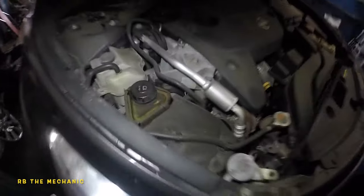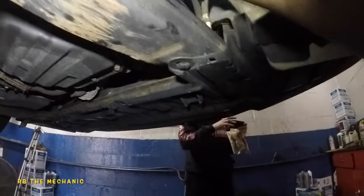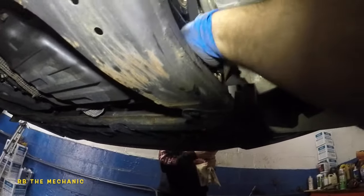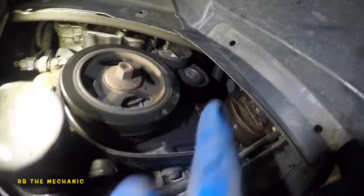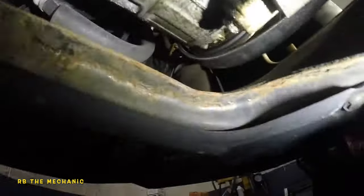What we need to do now is reroute the belt. It goes on the alternator, then comes straight down to the AC compressor. Let me get the belt on and then I'll show you the ending part. Don't worry about grease on it — it'll smash everything off once it starts to run. Belt is routed and also the water pump is up above; the belt is a little bit off so I'll fix that. You can see the AC compressor from down here if you need to.